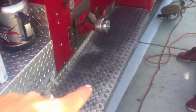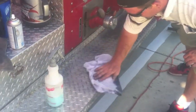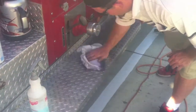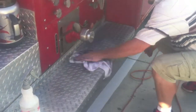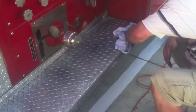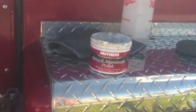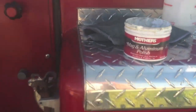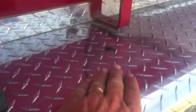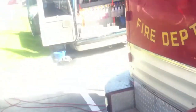You can see how it's real dark here — as soon as he starts to wipe that off, it'll all come out into the towel. I like terry cloths — they're a little more abrasive and they've got those little fibers, a little better than a microfiber towel. We'll wipe that off, then go over it with the final polish. We used Mother's Mag and Polish — works really good for this stainless. You can see right here where we finished and where we're starting the next section — comes out real nice.